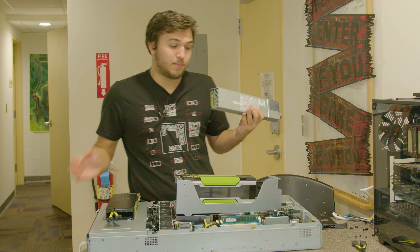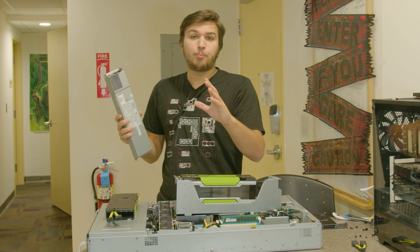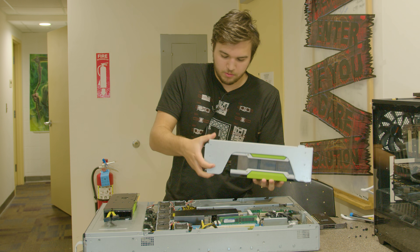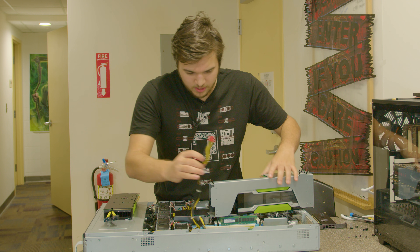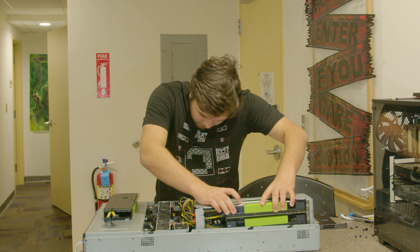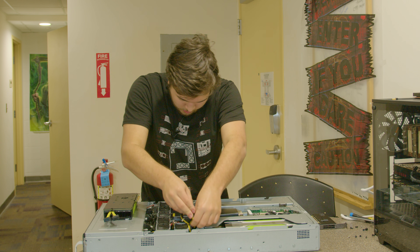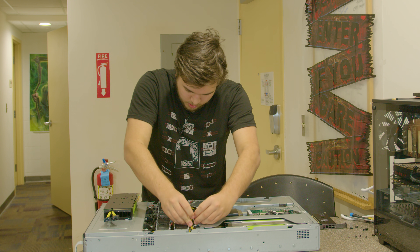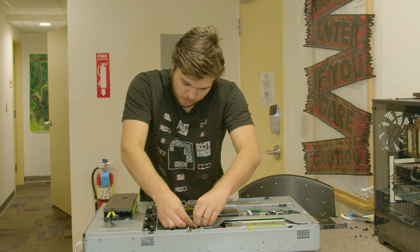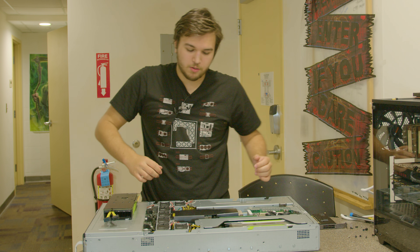These things are kind of freaking awesome, and they definitely need to be, because this server at full tilt — which it will be at consistently — can draw upwards of a kilowatt. Getting this in and powered with two GPUs is a bit of a complicated process: we want to connect our power cables first, then try our best to shove the now much heavier risers into the provided guides and get the power cords back in there. Try not to get them in these fans — they spin at a couple thousand RPM and are very loud, and we don't want cables getting in them because they will get immediately shredded. Two GPUs successfully installed.